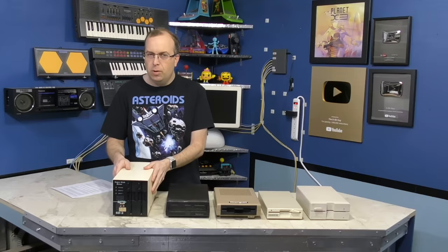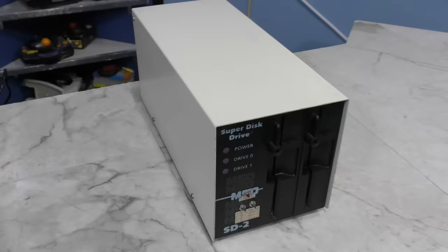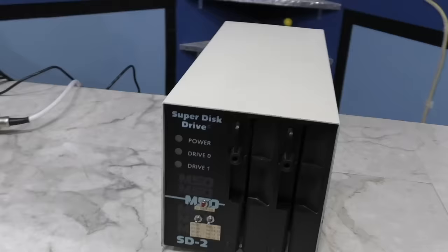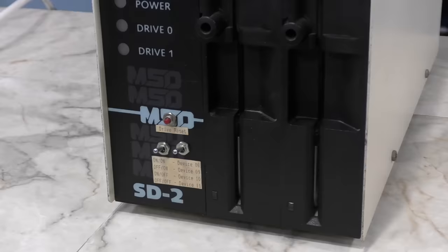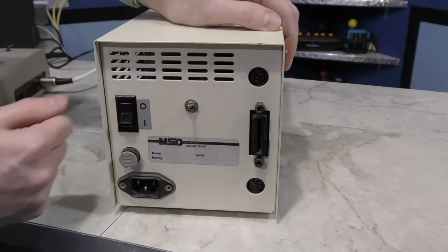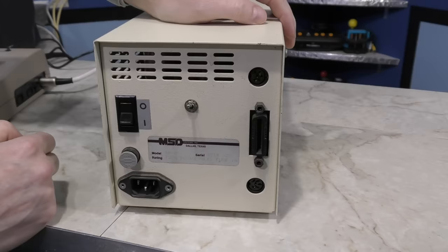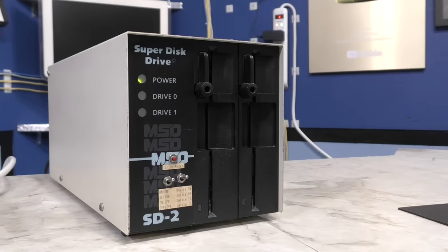Let's start with the MSD drive. This was actually one of the first drives, and it's actually really heavy. This is actually a dual drive — it has two drives in the front of it. They also made a single drive version, which I do not have. The MSD-SD2 is an industrial looking drive with a metal case. This particular one has been modded with toggle switches to set the drive number. There's also a drive reset button. Then it has the regular two serial ports, like any Commodore drive, but also has an IEEE 488 port so that this drive can work with PET computers as well, which were still popular at the time of this drive's release.